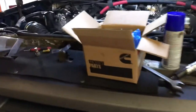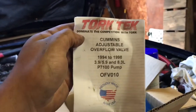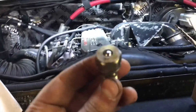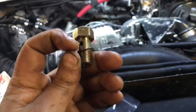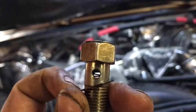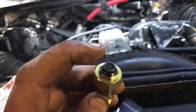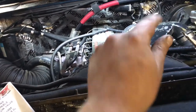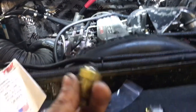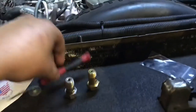We've got the Torque-Tech overflow valve. Basically what this does: the stock overflow valve on the older style is just a ball bearing pressed on one side with a spring holding a ball bearing at a certain psi — you saw it was only doing 10 psi. This one is the same concept but it's removable and you can adjust the preload on the ball, which gives you more fuel pressure by allowing less fuel to slip past back to the return tank. All it takes is two O-rings and a three-quarter inch wrench.